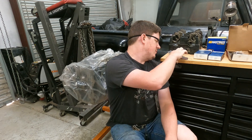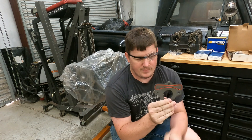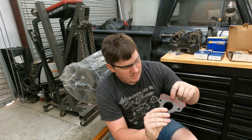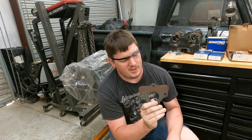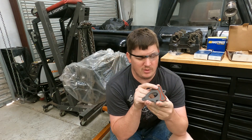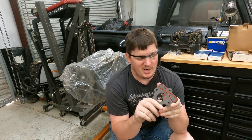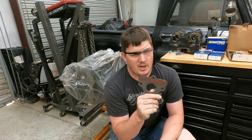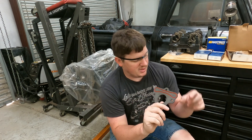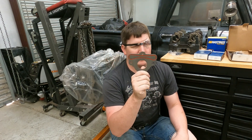The other thing which I don't show you as we're assembling this engine is the cam thrust plate. This gasket right here — be very sure to replace this. If you're not going to replace it, double-check that this gasket lip is raised above this metal plate, because if it's not, it's not going to seal and you're going to run into a whole bunch of issues with oil pressure, because this blocks off the main oil galleries that run the lifters.